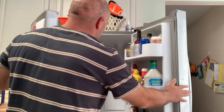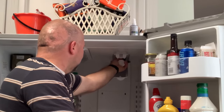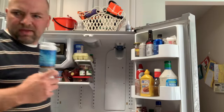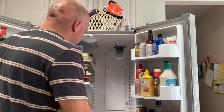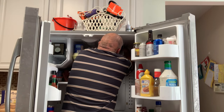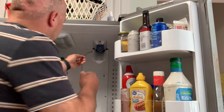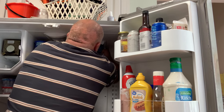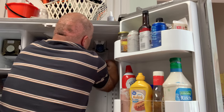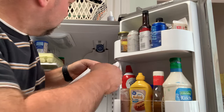Now we're ready to go ahead and open the fridge up. First thing I'm going to do is pull this down and go ahead and disconnect my water filter counterclockwise — it's a right little turn for the water filter to come off. You get a little water runoff with that, so I'm just going to set that in my sink and let that drain out a bit. The next step is really going to be opening up these sides just a little bit. There is a pin that runs across the top there and once you pull it off, it separates. You can see these little plastic rivets — you just pull far enough that it spreads over and pops out of there.